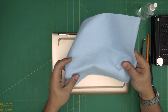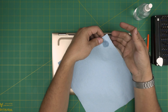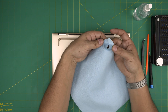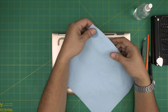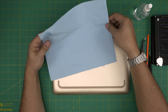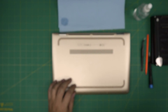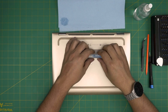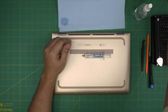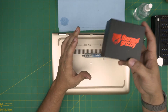You'll need one sheet of workshop towel. I always recommend workshop towels because when you soak them in alcohol and clean over a component, you can rip the towel apart and it will not damage the components. If you use microfiber towels, they can snag on capacitors and damage the motherboard. You'll also need a good thermal paste — I'll use Arctic MX-4, or you can use MX-5 or MX-6 if you want to go overkill.